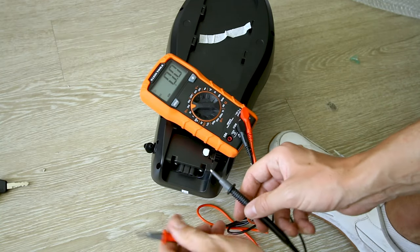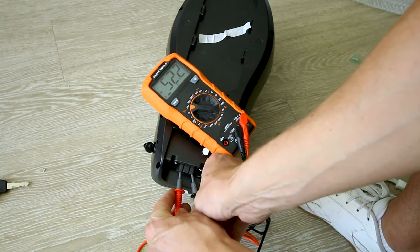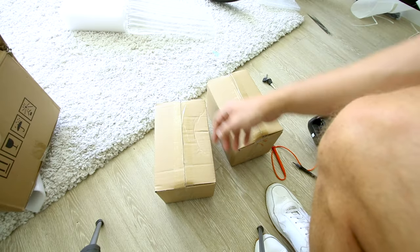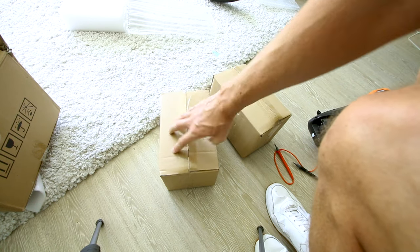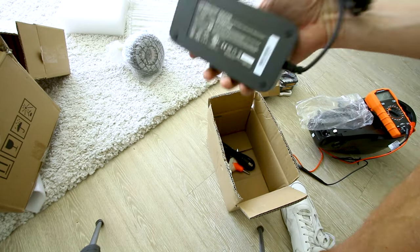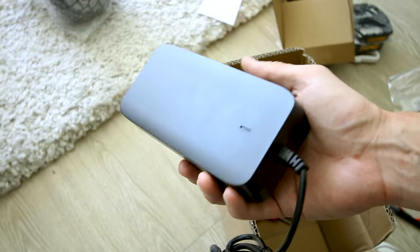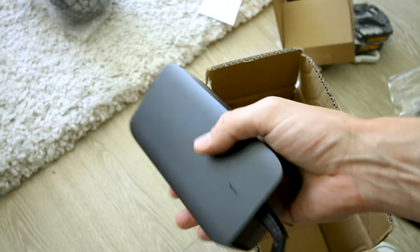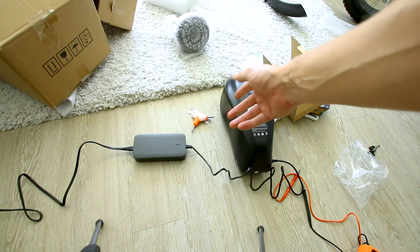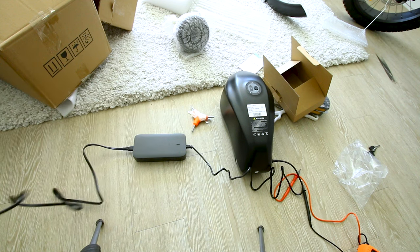The little blue bar says it's fully charged which would be 54.6 volts. Let's see where it's charged at — 52.2, so about 80% charged. One of these boxes is the charger and one is the headlight. We get pedals and a charger — it's a 3 amp charger, definitely a little bit more quality than some of the cheap bikes I get. So 27 amp hour battery divided by 3 amps is about 9 hours to charge from zero. Since it's almost fully charged it'd only take about an hour or two to top off.